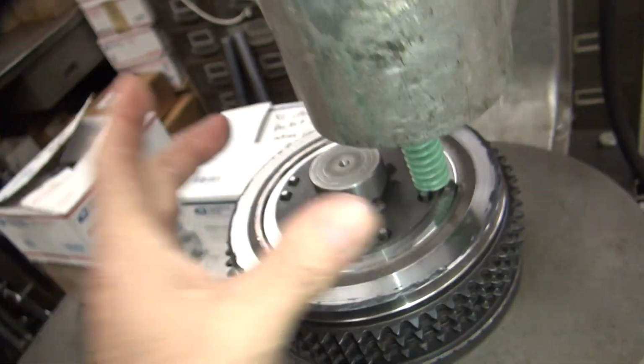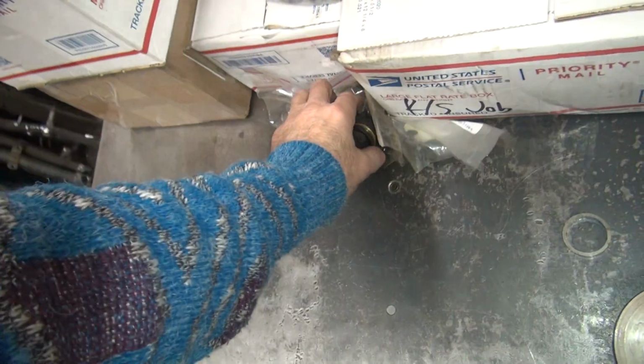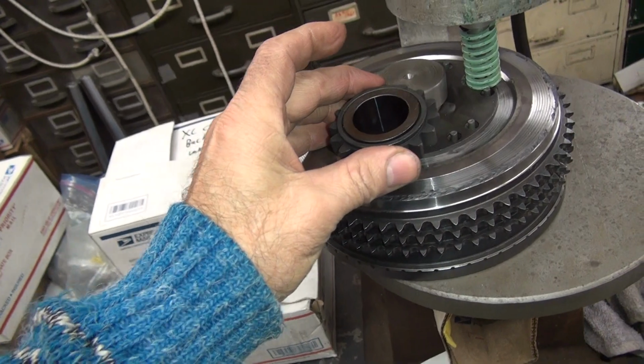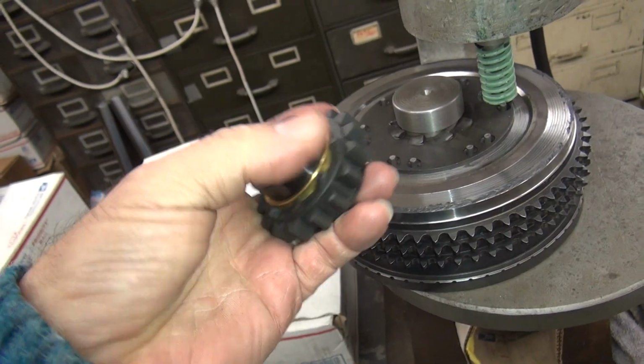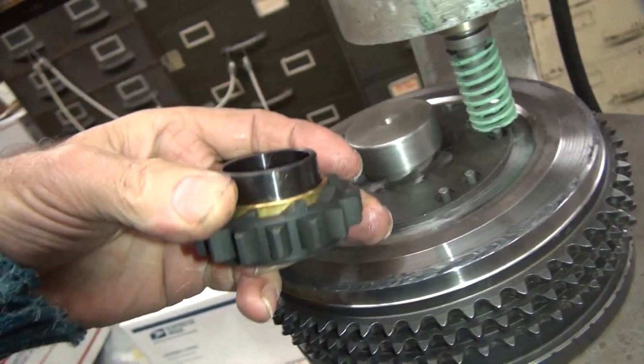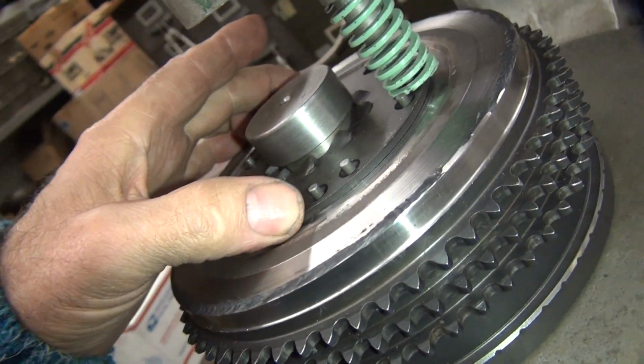So that keeps the kicker ratchet concentric to the shaft, so when you're turning it, it's not knocking this thing out because it's going like this. It stays concentric so it rotates evenly. Because these teeth right here have to dig out of those teeth right there. Now I'm going to back cut these teeth also, which I haven't done yet. I'll do that after it's assembled.